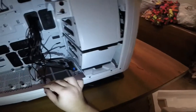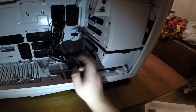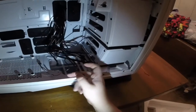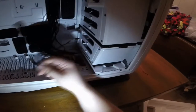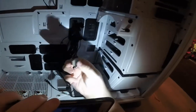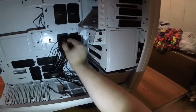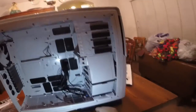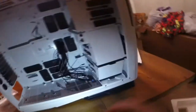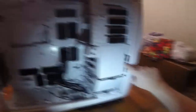So is it four USB 2.0 or just three? This one here is the HD audio — and these two are for the USB ports, essentially two per port. This will connect up for your audio jacks. There's also a SATA connection, which might be for the card reader. Then you've got some three-pin fans. Pretty much everything I'm using for cooling is going to be four-pin. There's a 200mm fan on the side and in the front, and then a 140mm fan in the back.